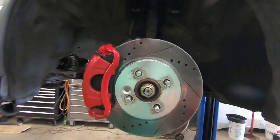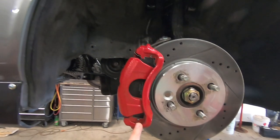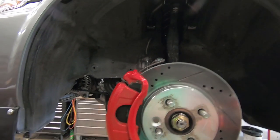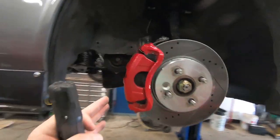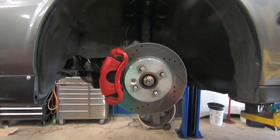To cover it again: you're going to need 07 Mini Cooper brake rotors, ITR Integra Type R brake caliper and bracket, and 04 to 08 TSX pads. You're going to have to trim the back plating to fit these calipers, or you can delete it like I did. You're also going to have to delete the spring for the caliper that sits on the inside, because you will have interference and get a whole lot of squeaking and rubbing noise. I had the springs off and have had no issues. I'll put a link in the description for all the parts, and I got all my parts off of eBay.